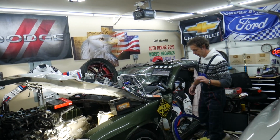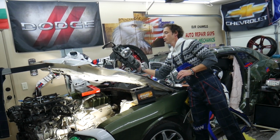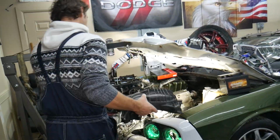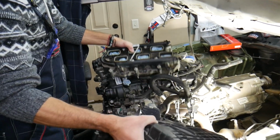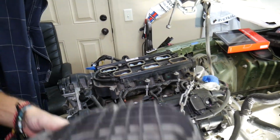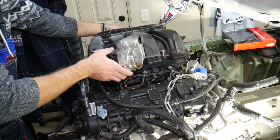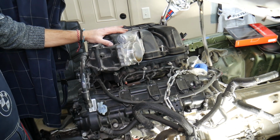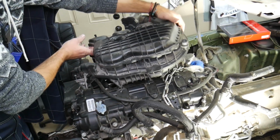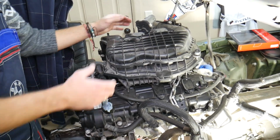So guys, let's explain, on that 3.6 engine, what you need to do in order to get to the oil temperature sensor. So that will be your engine right here. Give me a second, okay? I want to show you a few things. Here on top of the engine you're going to have your upper intake manifold installed. That's your upper intake manifold. It will be like this one. Now, actually it will be facing the other way, excuse me. This way.